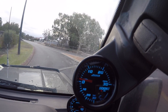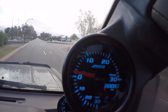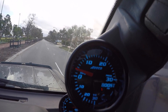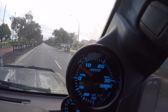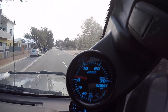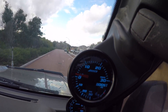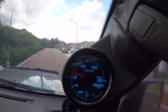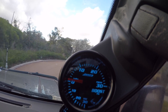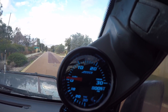I wish I'd done a video before to show you how laggy it was, but here's it coming on boost now — massive improvement. Second gear, 1500 rpm, put my boot into it and we're at full boost already. Before that would have taken a couple of seconds to work its way up to full boost. Only running stock boost at eight to nine psi. Next job on this is going to be a boost T so we can wind some more boost in, and then I'll have a mess with the main fuel screw and put some more fuel in. I'll probably do another video for that, so watch this space.